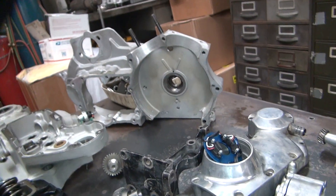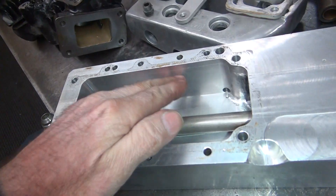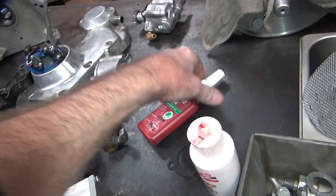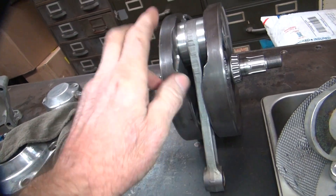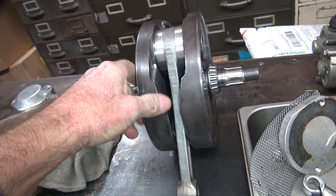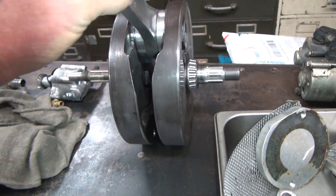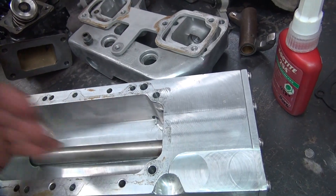The crank only gets down to where my screen is, so I've got a gap there plus all this height — a lot of room for oil and air volume, so crankcase pressure doesn't change much as the piston goes up and down. I also opened the flywheels up in between here as much as I could — my 500 set was opened up a lot, about thumb-width void. You want air to be able to go down through the flywheel without hitting anything. That's another reason for the lead — it makes it smoother. I also tapered things in there to remove sharp edges so air can flow through, into the pan, and out of the motor.